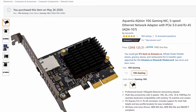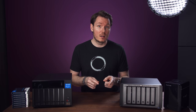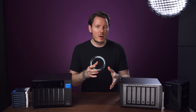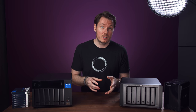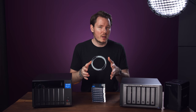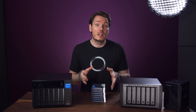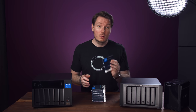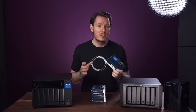For the 10GB network cards for my computers, I went with the Aquantia AQtion 107s — I got their 10G gaming cards for $125 Canadian, under $100 USD. They installed fine, and Windows 10 recognized them and installed the latest drivers automatically. I calculated my total storage needs at about four to five terabytes — up to three terabytes for video editing projects and about one terabyte for personal files and finished videos. I decided to go with six two-terabyte drives in a RAID 10 array.